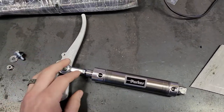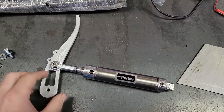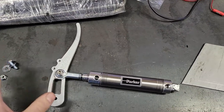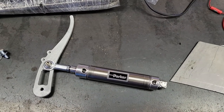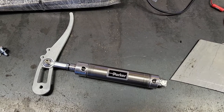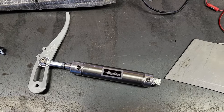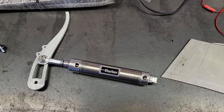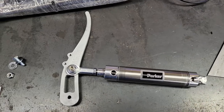Here's what we got so far: the chute handle and CO2 cylinder to activate the chute. We'll be able to activate this manually if wanted, but I'm going to have the ECU control it. I haven't decided if I want to put it on a button or have it as an automatic deploy — say above 150 miles per hour and 0% TPS. That's kind of my thought, but not sure on that.